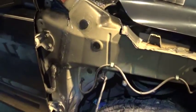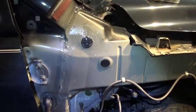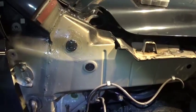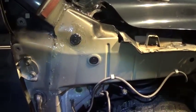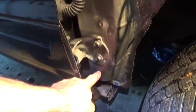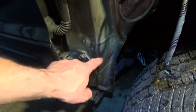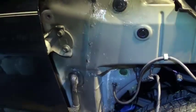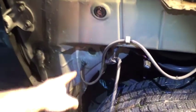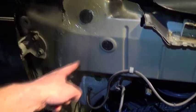This is fixed. It was really hard to find the problem, and I sealed all the way from the bottom all the way up — it's okay now. Just pay attention: look behind the fuse box and find that little hole. If the water comes from that area, it will drip down and start to fill up this area until it gets to the point where the hole is, and it will start going into the car, onto your floor. That's where it's coming from. If you seal this and that takes care of the problem, you're in luck. But if it doesn't, then you have to take the fender off and seal the seam as well.